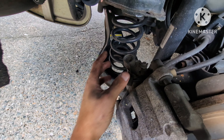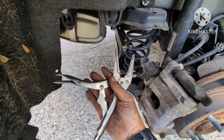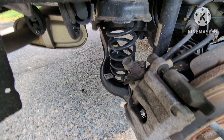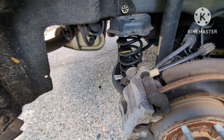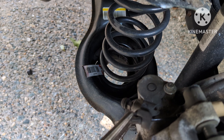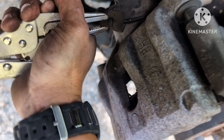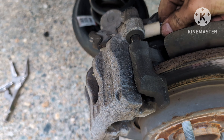I'm going to remove the e-brake cable first — it is kind of tricky. What I did was use this tool, clamped it down, pushed it back, and removed it. You can also remove the spring since the new caliper brings one; it makes it much easier. Just be careful because it goes flying — that spring puts a lot of tension there. Now I can remove the e-brake cable. It does take both hands but you get the idea.